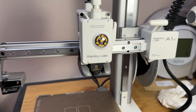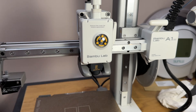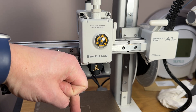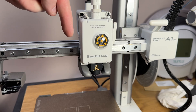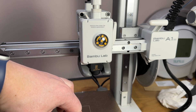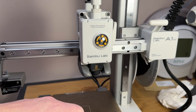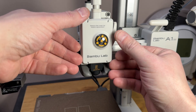In tonight's video we're going to have a quick look at how to check and fix your BambuLab A1 or A1 mini extruder where the nozzle has become loose. You'll normally notice it as a bad first layer where it's just not calibrating the nozzle height off the bed correctly. As the nozzle comes down it's loose, pushing the nozzle up, so you don't get an accurate measurement. Then when it starts to print, the filament is forced down into the nozzle, pushing it down, which means that 0.2mm allowed for the first layer is now non-existent — basically dragging the nozzle on the bed. It's a very easy and common fix.